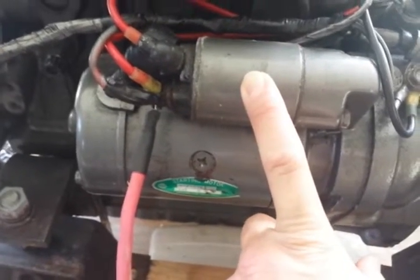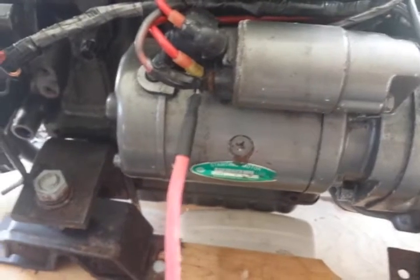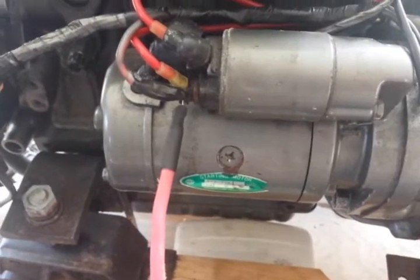And you don't really want that. I measured it's about an amp, maybe upwards of a couple. So it's not that bad, but it can burn your contacts pretty quick. So you put in one of these guys over here.